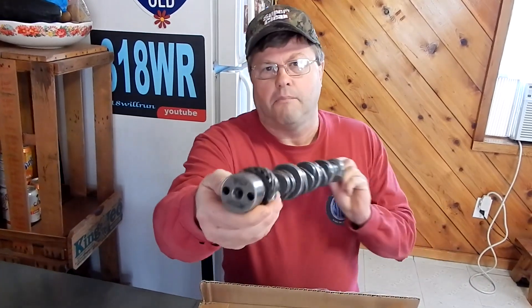Basically this cam is meant for a 360 Magnum in a tow vehicle to add a lot of mid-range off-idle torque. The RPM range they suggest is idle, basically a thousand RPMs to five thousand. It's a 480 lift cam, duration at 50 would be 212 intake and 218 on the exhaust. It's got a lobe separation of 114 and the centerline is 110. In a 318, reviews say it acts like a mild street cam — gives you a little bit of a lopey idle.